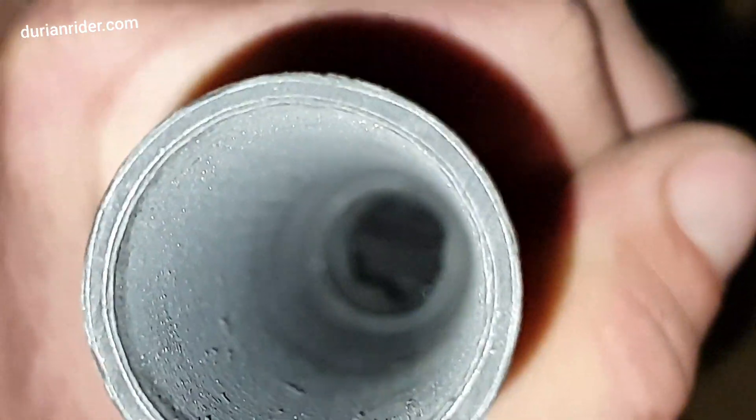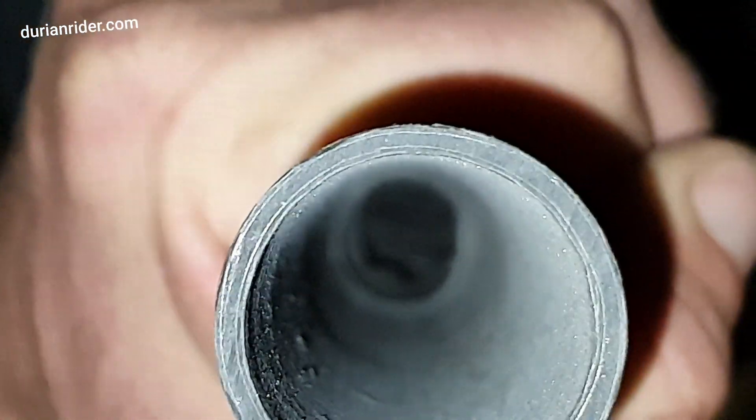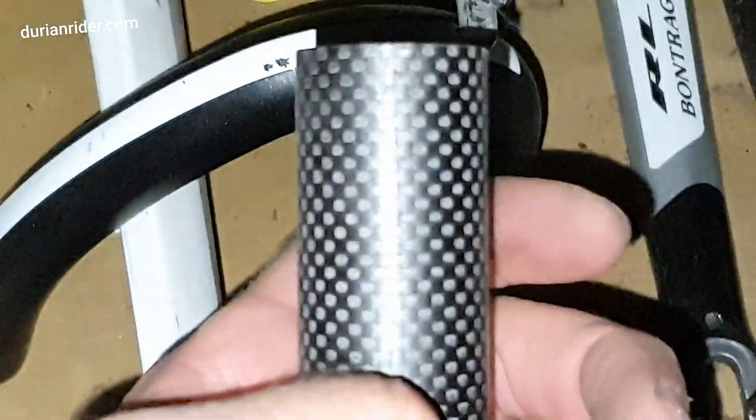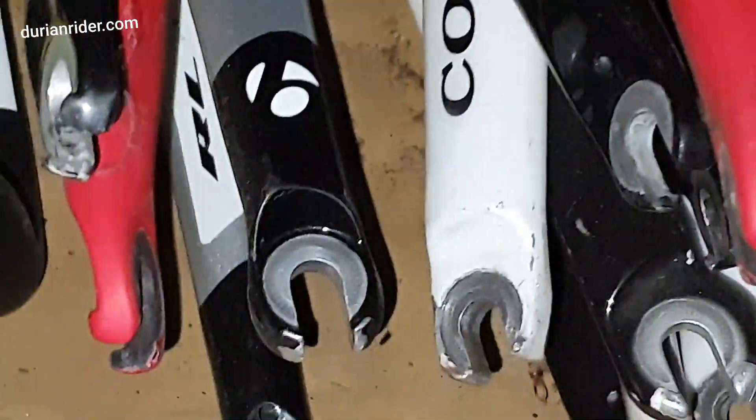You could also look inside and see if there's any dry fiber — there's no dry fiber in here, that looks pretty good. Down there you can sort of see the bag. I'd be looking inside, and if you can't see any flaking off, that's a good sign. If you don't see any ring barking, that's a good sign. If you don't see any cracks around the stem, that's a good sign. You should always drop your fork out every few months anyway if you're riding a lot — probably every 5,000 kilometers.